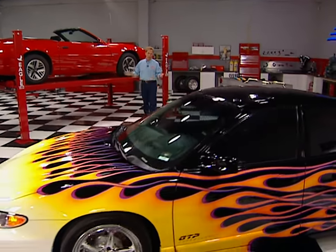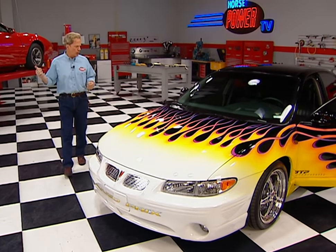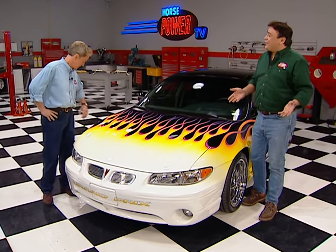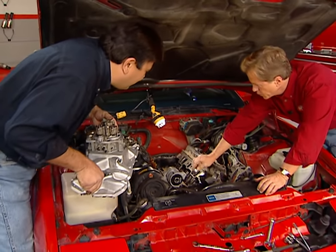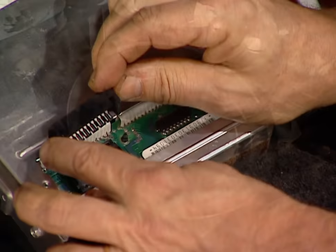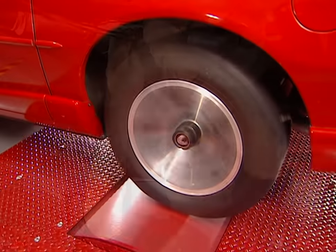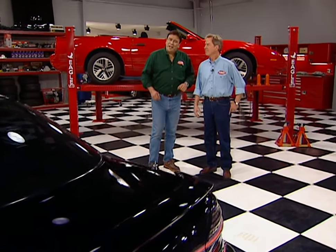Welcome to Horsepower TV, where today we've got a great pair of Pontiacs in the shop. If you've been watching lately, you know about this '91 Firebird we've been working on. We've also got a tricked-out Grand Prix with a supercharger and a first-rate flame job. We're trying to build the Firebird on a $10,000 budget including the price of the car. We first did a high-tech tune-up with a new manifold, ignition upgrade, underdrive pulleys and computer chip, then headers, cat-back exhaust and a catalytic converter — almost 40 more horsepower at the rear wheel. Now it's time to turn our attention to handling.